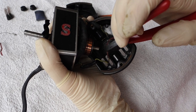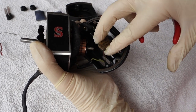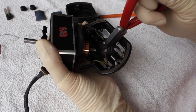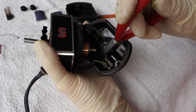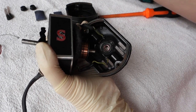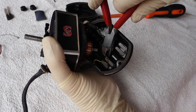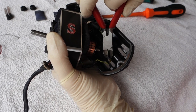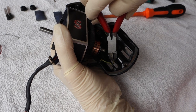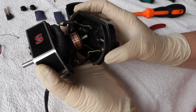Same on the other side — cut the capacitor wire about a centimeter from the attachment point, take the capacitor out, and use your wire cutters to pull that plastic sheathing off if you can. Now you can see clearly where to cut. Make sure you have a good view — you don't want to cut the tab or the other wire by mistake. There we go — the capacitor is now out.